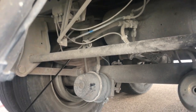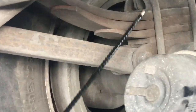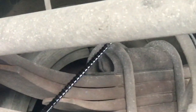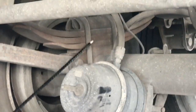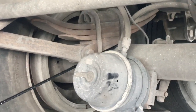Here are your leaf springs. Make sure your leaf springs are in line with each other, not cracked, bent, broken, or damaged, and free of any illegal welds. They are bolted down with U-bolts — make sure the U-bolts are present and tight, not cracked, bent, broken, or damaged in any way, bolted down to your tandem axle.